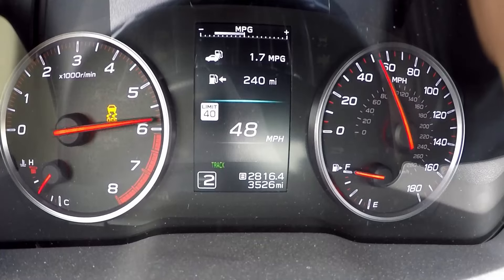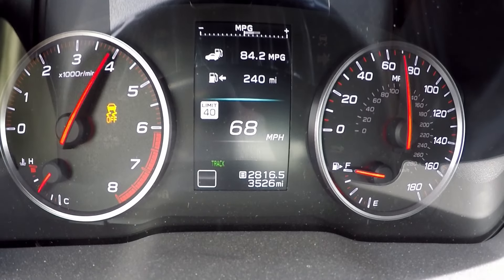Typically, we look at what RPM you'll be at when you shift to the next gear after reaching redline in the gear before it. In a drag racing situation, if you get to 6,500 RPM in second gear and immediately put it in third, the RPM in this car drops to about 4,800 RPM. That's the RPM you'd set your flat foot shift to. It essentially takes the engine RPM to the perfect spot, putting way less stress on your synchronizers in the transmission.